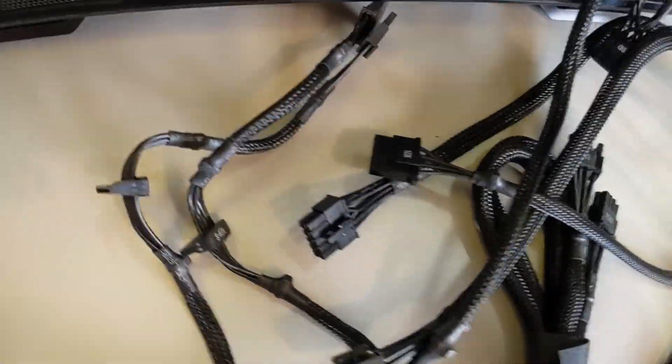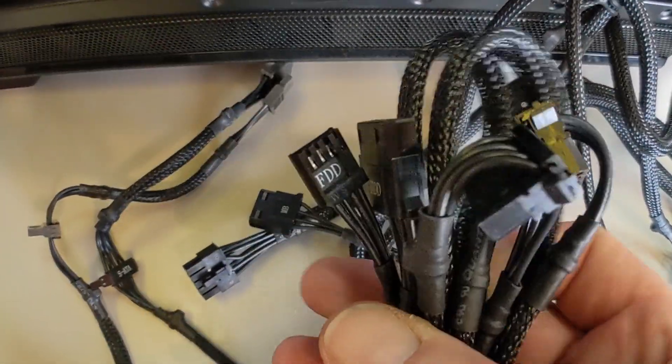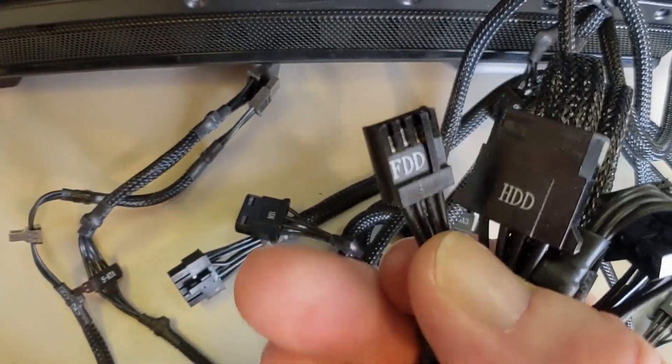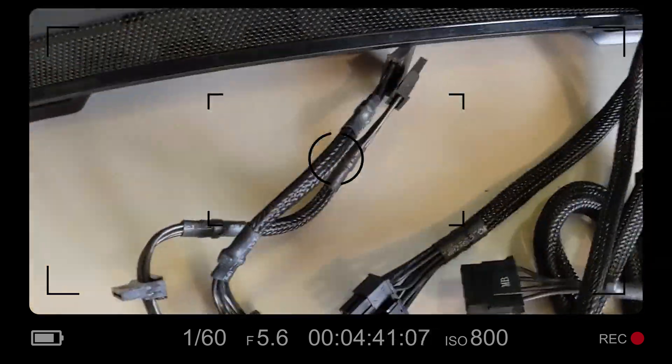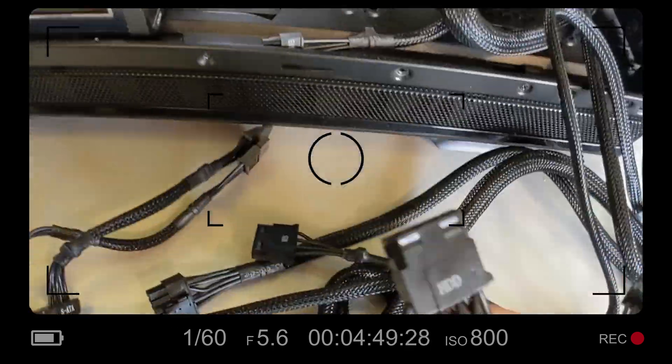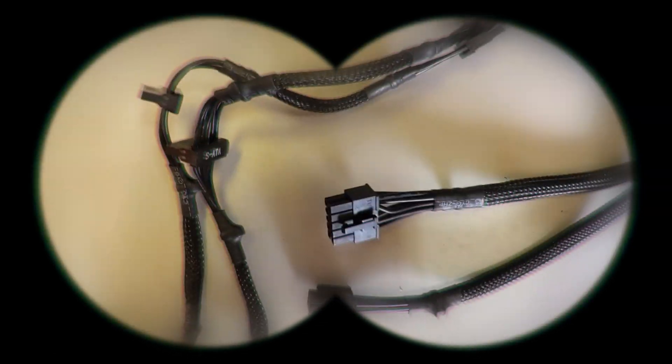Here's a bundle of drive cables that has nothing but old-style Molexes and floppy disk connections — nothing for me here, so it goes into the box out of the way. Having unused cable clutter blocking airflow and adding to mental stress is not worthwhile. Set aside anything you can't use, then start working on what you need. This one was marked BGA3, so it's for the third graphics card. It inserted into the PSU slot labeled PCIe3. This PSU came with enough cables for three graphics cards, but I only need one.